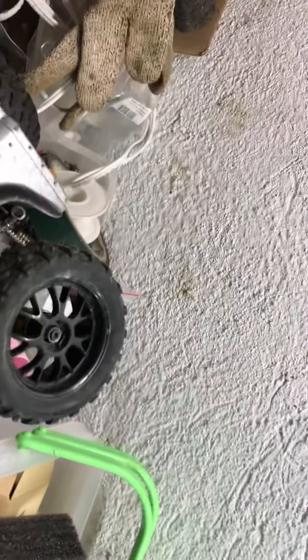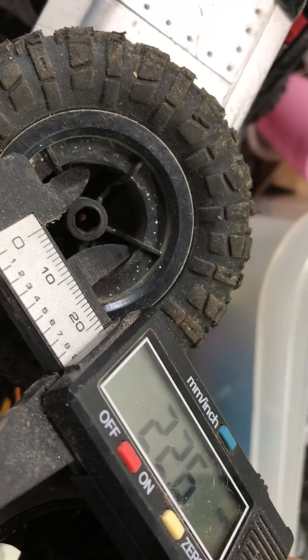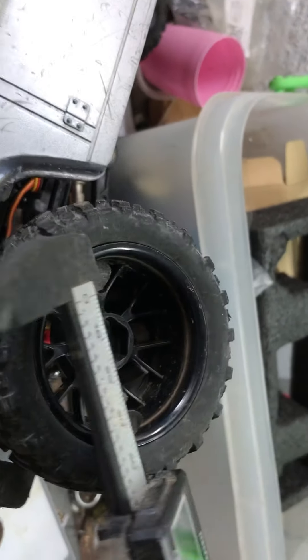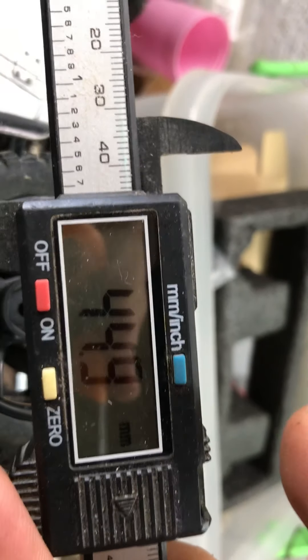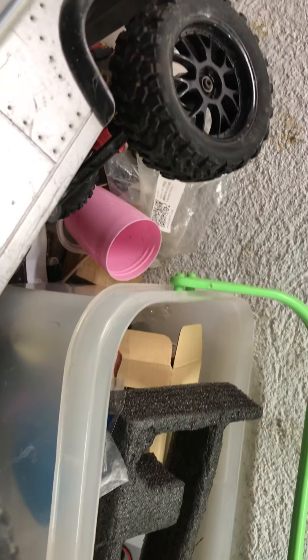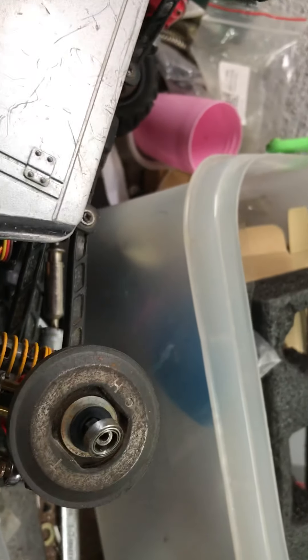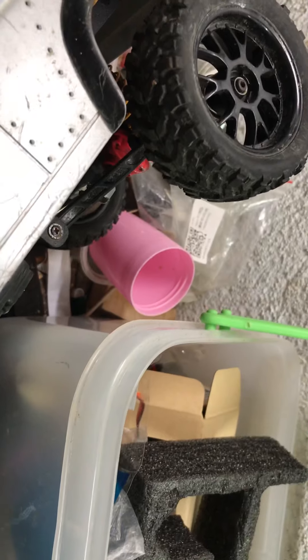Comparing the two setups: with the old wheel you only have about 21–22mm diameter working area on the knuckle, but here with the 1.55 rim you have 44–45mm, so about 40mm to be safe. What I discovered is a very simple, very cheap solution: a flange nut.